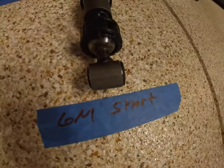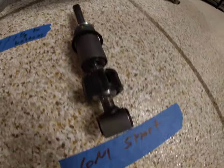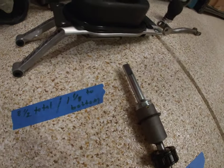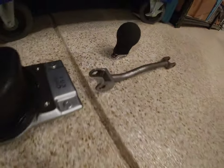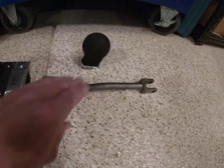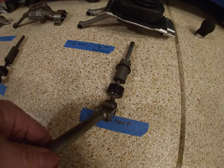GM has a short throw shifter, which sounds great — you buy the whole assembly, but really all you need is the shifter lever arm itself; you can swap that into your original assembly. This one is about the same overall length, but the bottom measurement changes slightly as we change how the lever arm connects. This is the arm that connects directly at the very bottom, going up forward on the top of your Tremec TR6060.